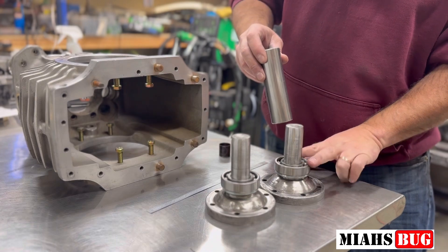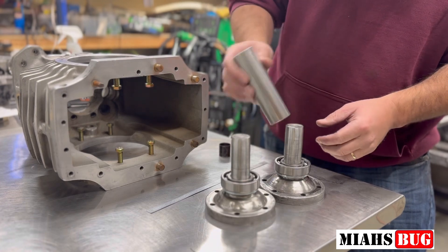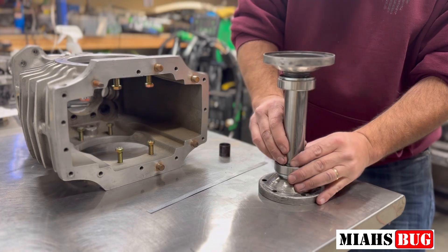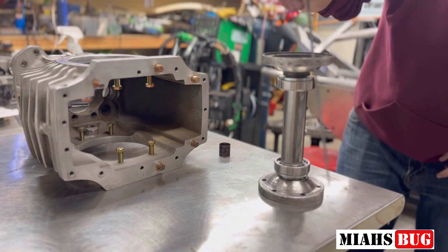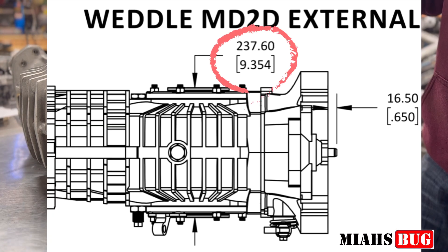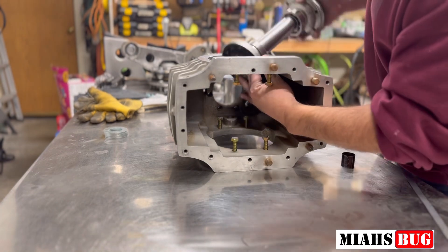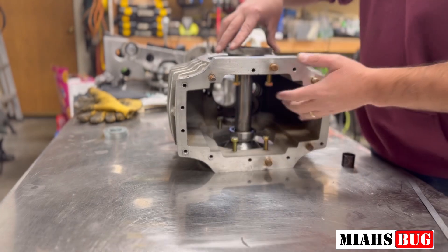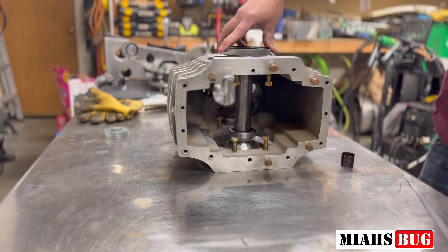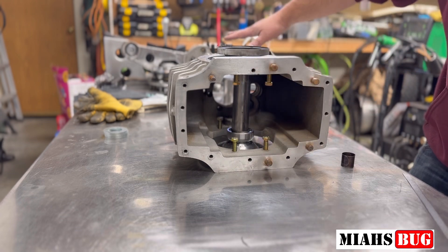This is the spacer that sets the space between the two bearings. I've got my two 930s — I cut these down to the half distance that I want, so these two touch right in the middle. Ideally when installed, this one would touch inside. The most important thing here, since this is setting our two CV cups inside our mock-up, we're setting at 9.35. Mine is at 9.35 — that's good enough. That is what the print says from Weddle. Once we have our plates built to bolt into the insides here, the plates will grab the two bearings and we'll be able to independently spin these two CVs to set all our axle angles. We're getting those laser cut out of HDPE from SendCutSend, and then we'll move on to getting our bell housing and nose cone set up.